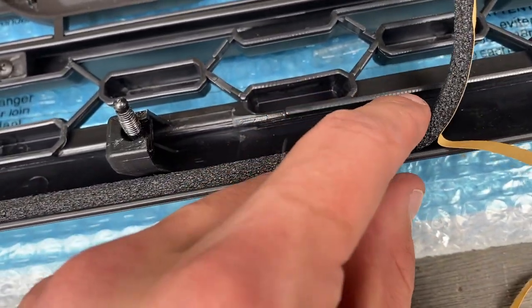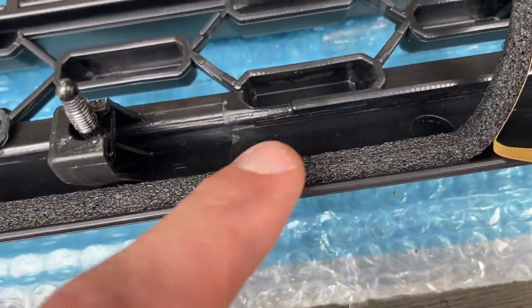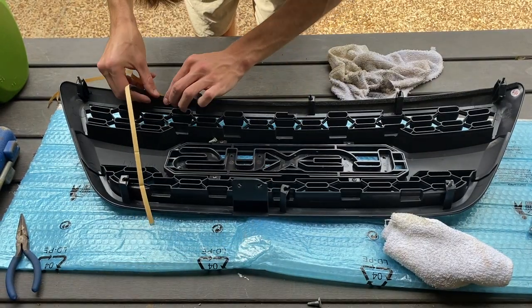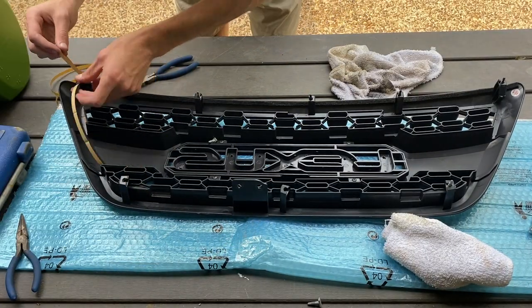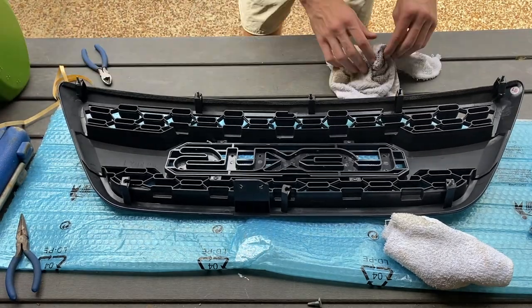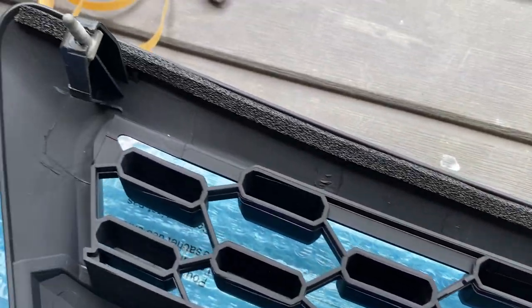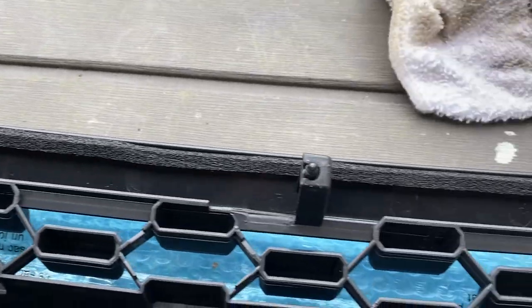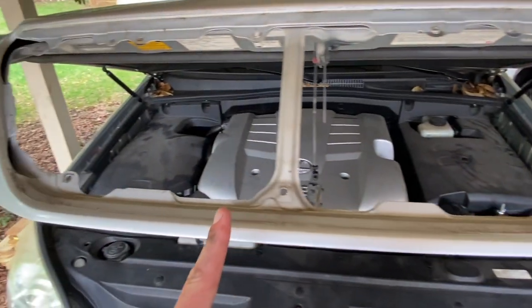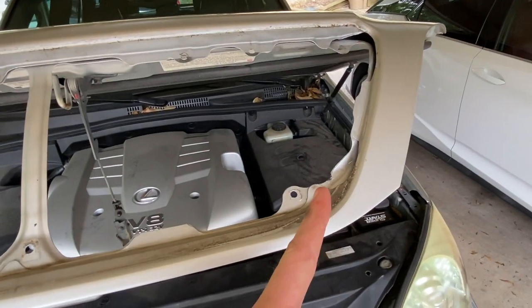I'm going to show a little time lapse of exactly how I'm doing it — just pulling off the adhesive and then laying it right under this lip on the top of the grille. The adhesive seal runs all the way down and helps seal in the top of the grille to the hood. Also, while the OEM grille is off, it might be a good idea to take a rag and wipe out some of the dirt and grime that's built up under the original grille.